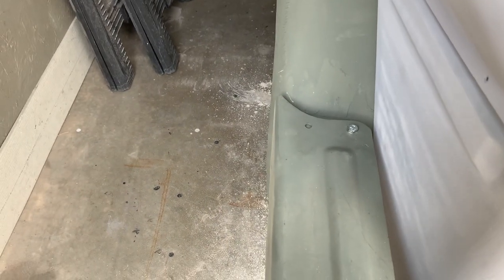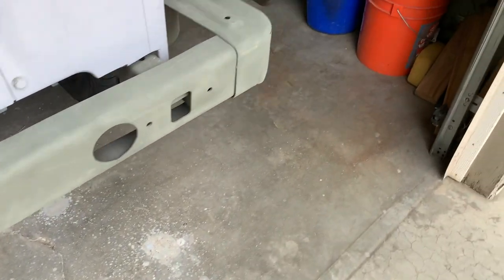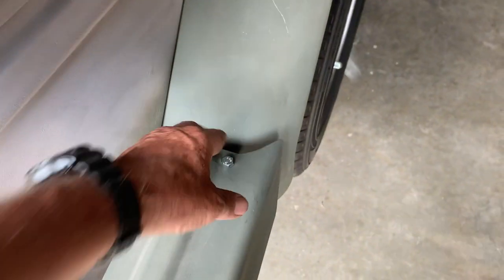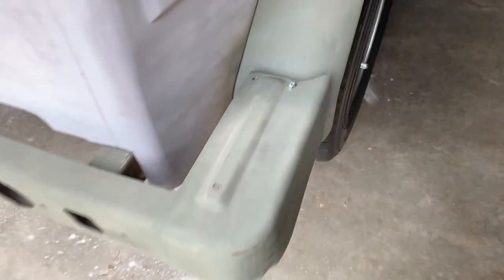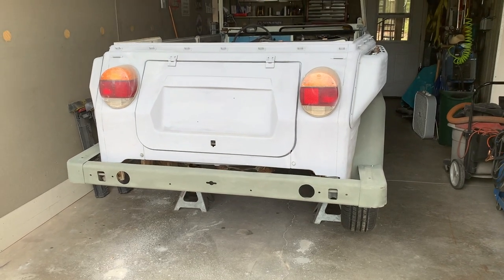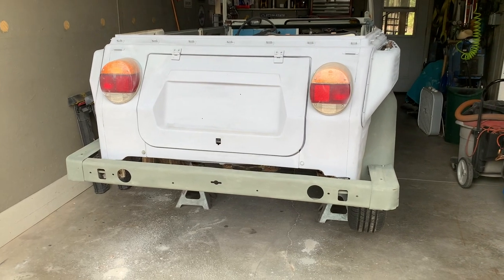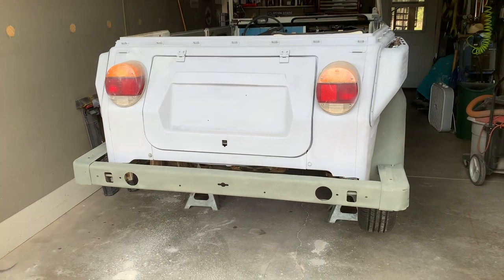Man, that looks so much better tucked in, even just about a half inch below the outside edge of the fender. Got everything squared away. Lowered that bracket down. You can't even tell I lowered it after I do the body work on it. So that was about 2/3 of a day's work to get that done, but that is the last of the rough body work. Now I'm just finishing up block sanding and get that done and push it out, spin it around, pressure wash underneath, and I'm ready for the mechanicals.